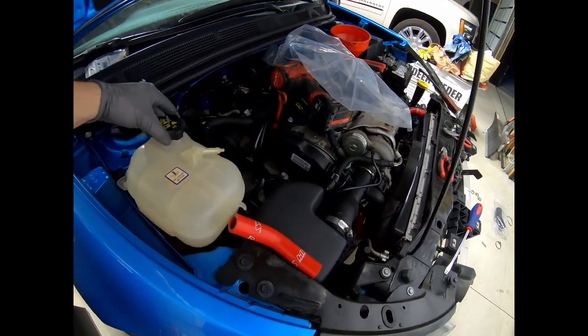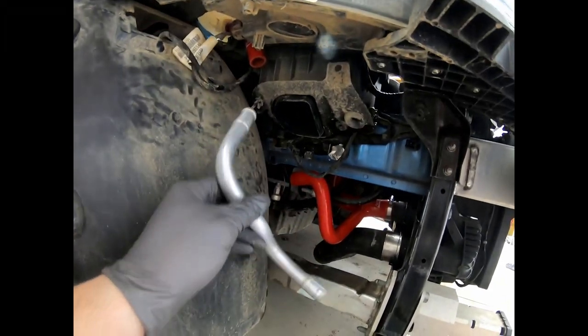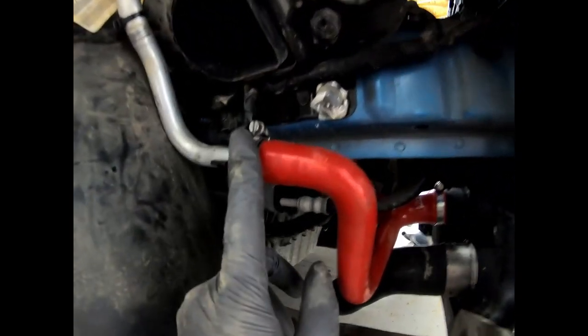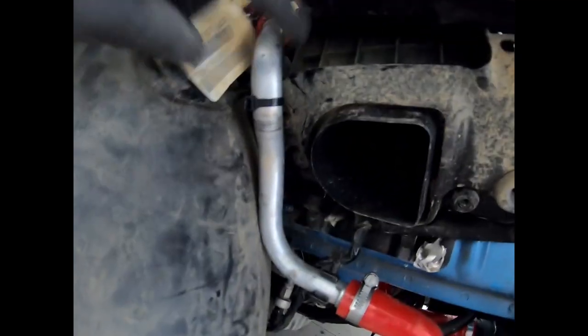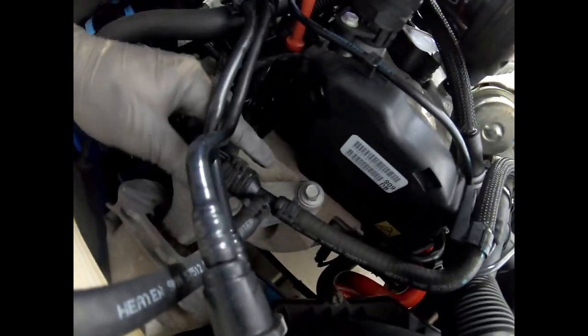This small piece that comes in the kit is going to go onto the bottom of this one right here, and then it'll get set back into place. Wrapping up: that top coolant tank hose comes down to right here, where the other smaller hose piece left off, and then that metal piece I had taken off goes back up into here. I'll match this up and get this last piece in — completed on this side. All the hoses are tight and buttoned down. There are little bracket pieces that help keep this in place, and I also zip tied it right here just to secure it and keep it from rattling against the splash shield. I'm going to secure the water tank back up, put the two bolts back in, get the worm clamp on, and then move on to the coolant T.